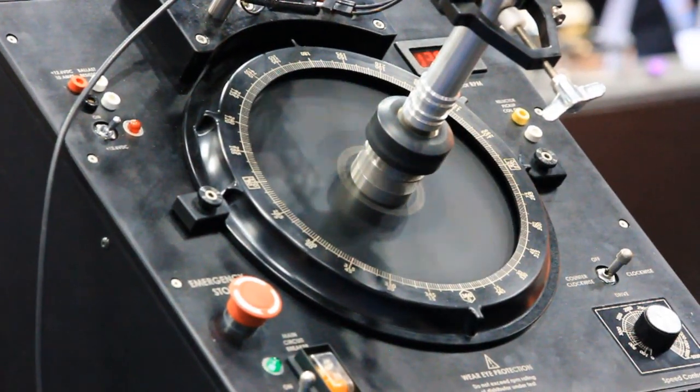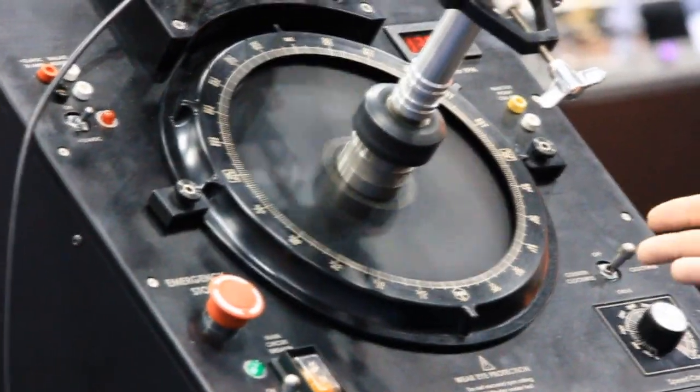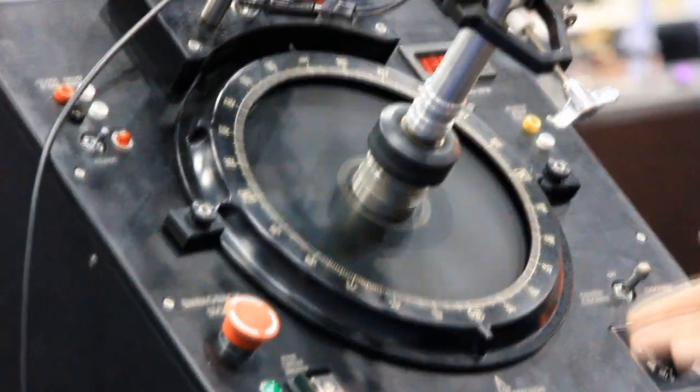And in a lot of the performance engines we found to go in here and retard 3 and 5 cylinder to help the durability and also help the power of the engine. So here we can find the firing order of a particular engine, adjust the cylinder to cylinder timing, and help that motor out.